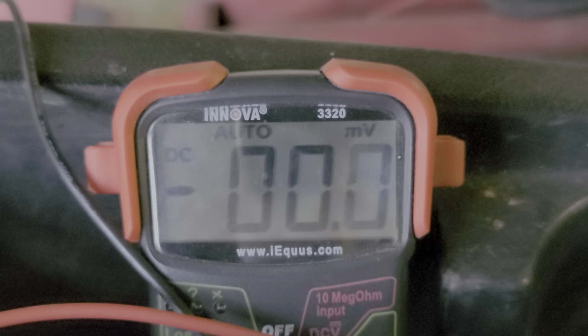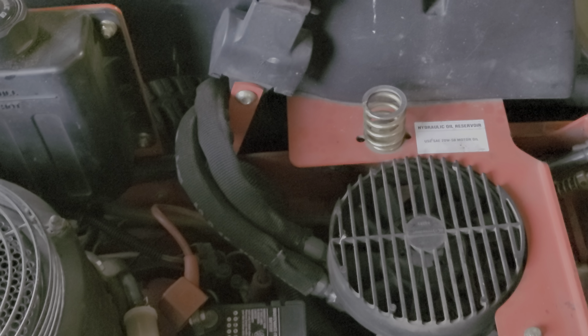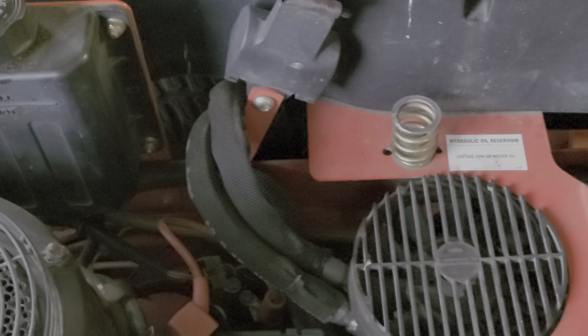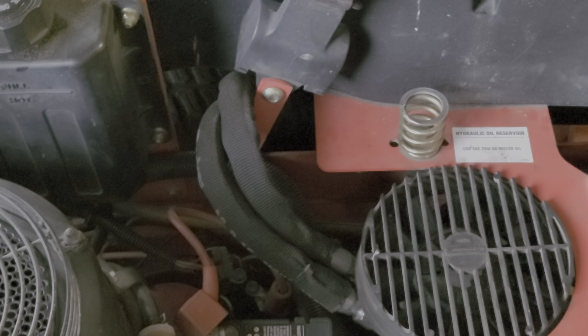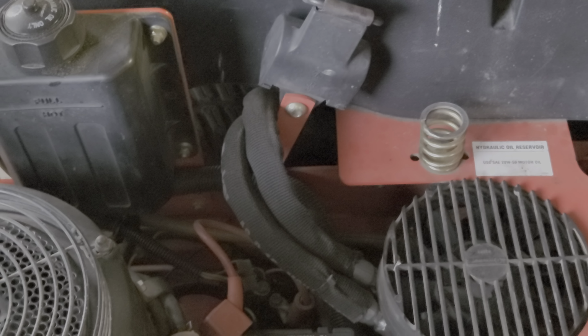As you can see, I am somehow draining the battery while mowing according to the multimeter. I have tried this with the wire connected, so it's actually supposed to be charging the battery, and I always get negative readings out of the battery side of the rectifier. I'll get you a closer look. Hang on.